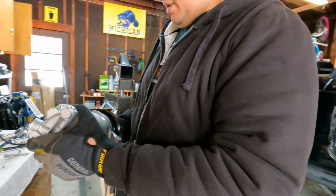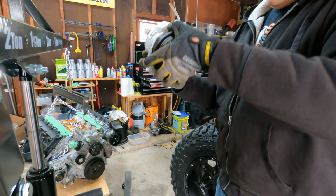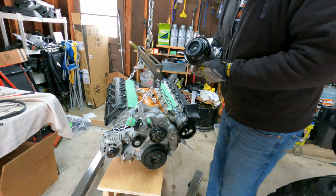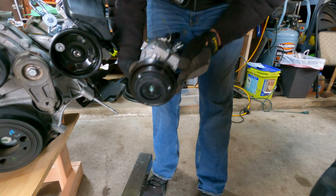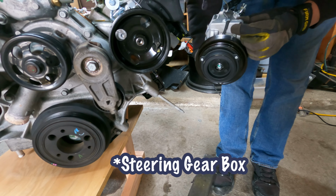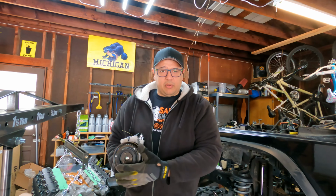And so this pump will attach like so. And we know that this spot right here, where one of the bolts goes, which is actually, oh, I apologize, it's this top spot right here. When this is up against there, this sticks out too much and will hit the power steering pump. So Jeep Speed Shop actually has a video that shows you how to modify this corner. So I figured, hey, why don't we start with that part right now?